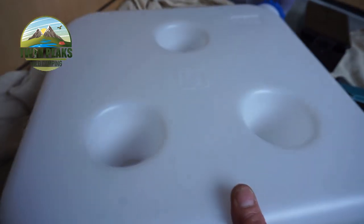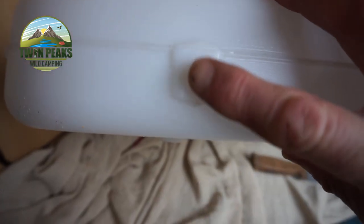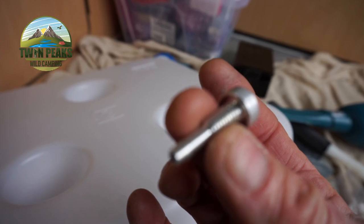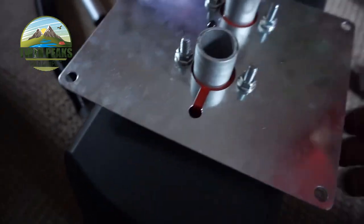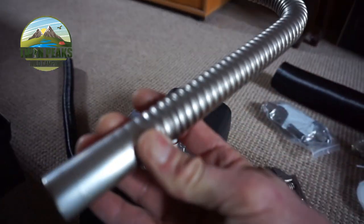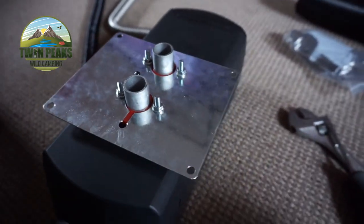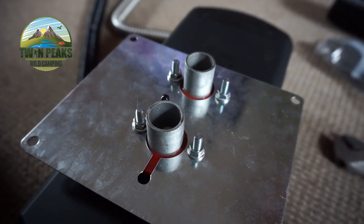In the meantime, I'm gonna get the fuel tank. What you gotta do is, depending where you want the fuel pipe to come from, you've gotta drill an 8mm hole either in the bottom or on the side of the fuel tank, and we've gotta thread that in through the hole. Back in the house now - we've gotta put all this together. The plate goes on the bottom, just gotta put the nuts on there and bolt them on. Then we've gotta attach the pipes and the fuel line, and then go back to the van and drop it all down the hole. Sounds simple, doesn't it?